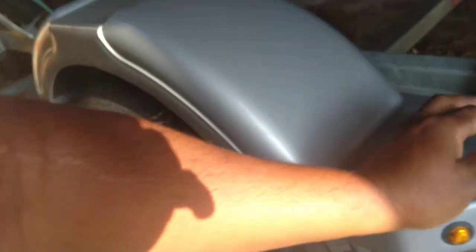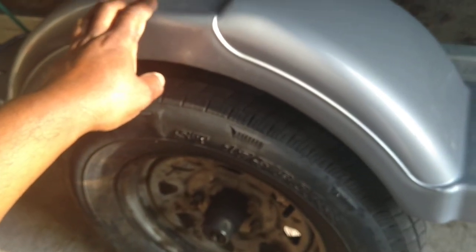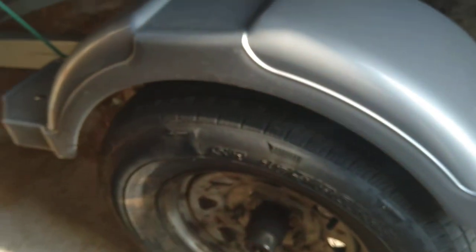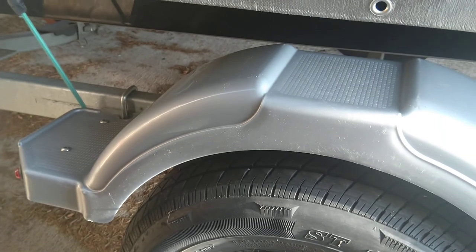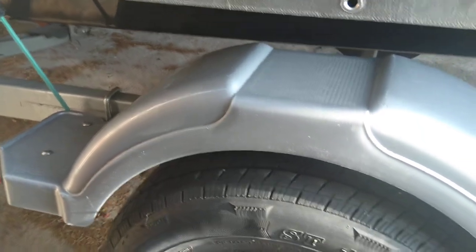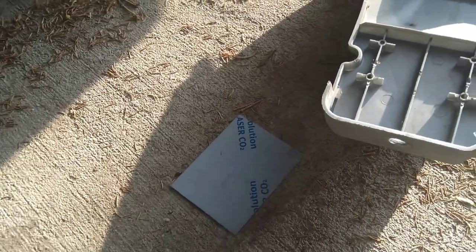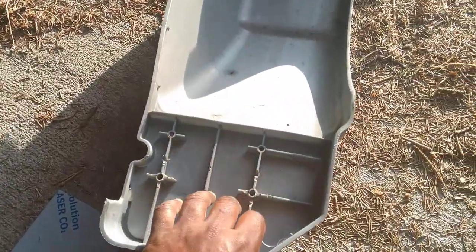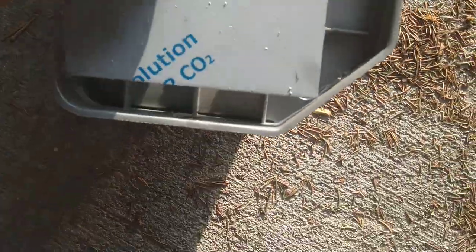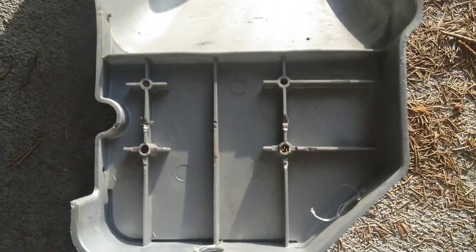All four pieces cost me $20, and the fender was $30 — I believe it cost $30 to ship it. You can also get the same fender from e-trailer for the same price. If you're replacing plastic with plastic, I recommend the four by six plate at 160 thousandths — cut it and match-drill it to the existing holes, and the bolts right in.